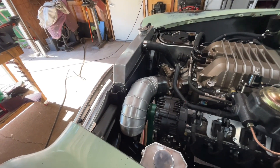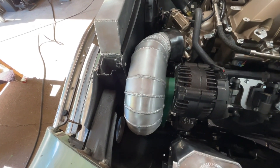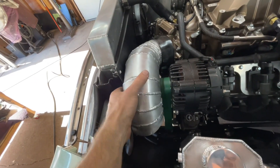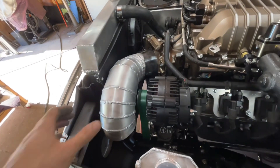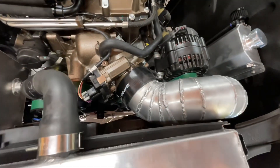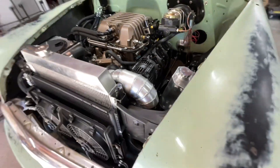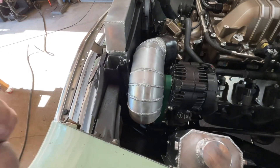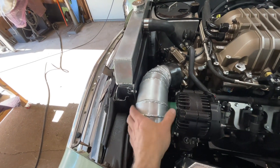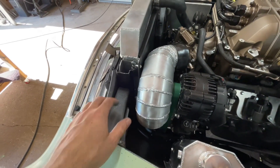That was so much welding — like so much. I finally got the hang of it, of course towards the end. The top sides look the less ugliest — I'm not going to say the prettiest. Aluminum welding is very difficult, I'm not going to lie, but it's sealed up. It works. It's one solid unit now, which is awesome. And now I can build off of this. Like, no wonder why people charge an arm and a leg for this kind of stuff — it just takes forever. Almost all my argon's gone. That big tank — it took half of it, but that was kind of my fault too because I didn't move quick enough. You got to move quick, like real quick. Once you get the hang of it, you can't just sit there and bake the part — just heat and dab, heat and dab. I might make a standoff to go from here to here just to kind of isolate it a little bit better.